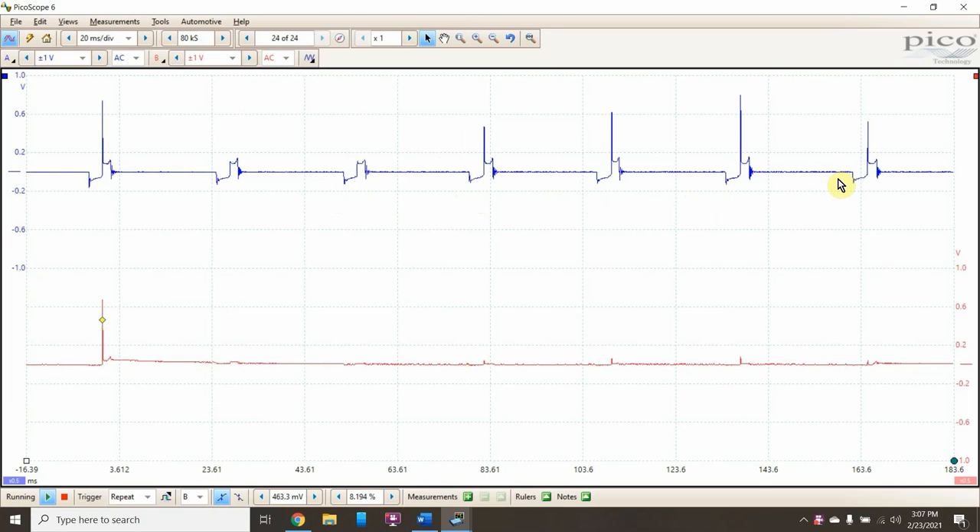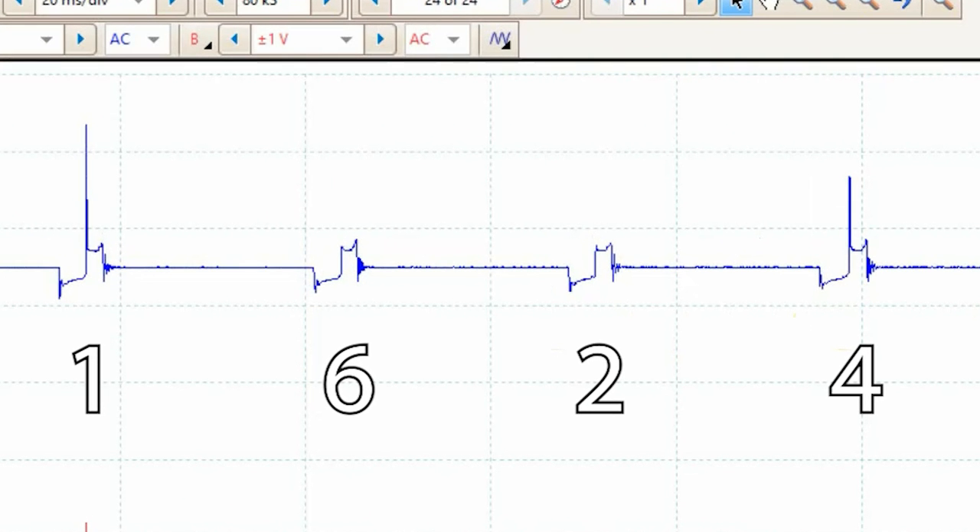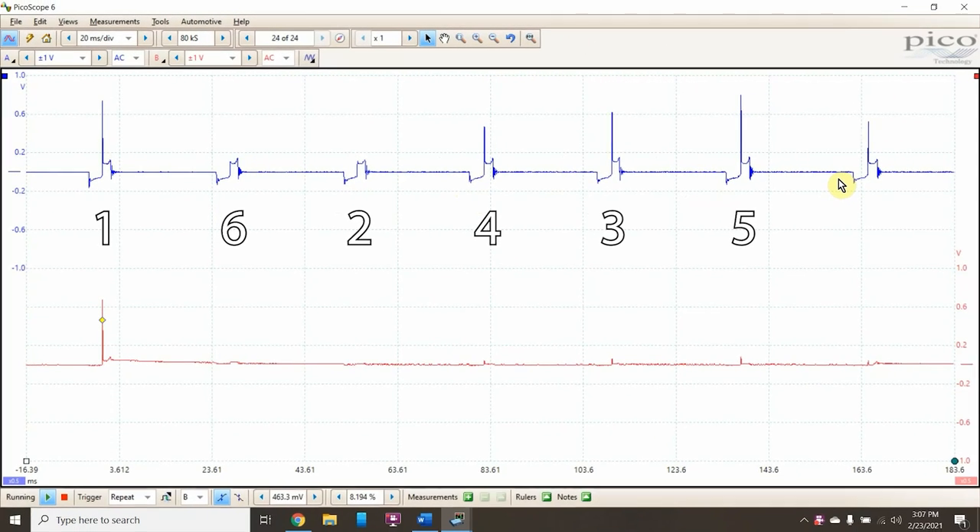Here's an image with the time base expanded a bit so we can get all six cylinders in. They're going to be in the firing order starting with cylinder number one, then six, two, four, three, and five. One thing you'll notice is that the firing line is missing for six and two — that's really more an artifact of this scope at this resolution and time base, as it's only an eight-bit scope. We can still tell quite a bit though. The burn section is trending up quite a bit towards the end, and this was taken before I took the car to the shop to get the CO set. It looks like across the board, all six cylinders are a bit lean.